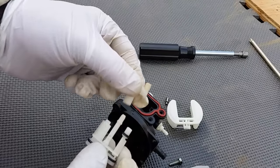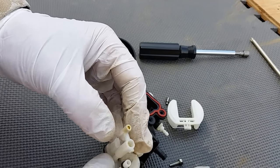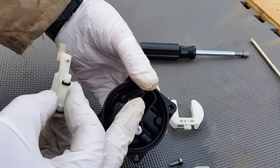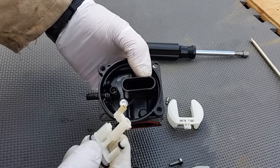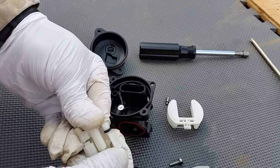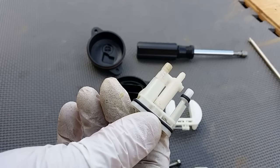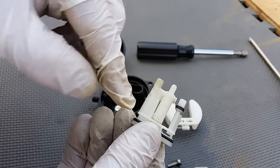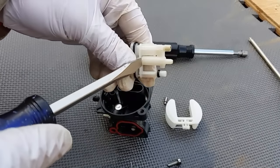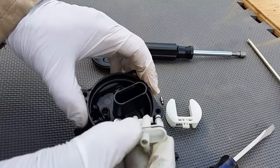This is going to sit with that nubbin in this one — that's a dead-headed little valve. Then this one has an o-ring; the key is it's going to go back into the higher hole in your carburetor, so don't get them backwards. Push it in nice and easy. This is tight — I had to get up and put it by my chest and push with both hands, real straight, to get this to seat. The screwdriver goes in here and this is how you work it up. Once you've got this, the o-ring goes in the tallest slot — in other words, the o-ring goes away from the needle valve.